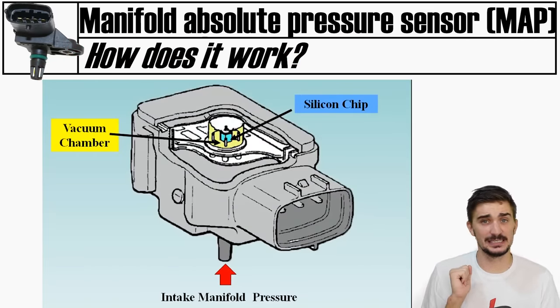The IAT sensor or intake air temperature sensor measures the temperature of the intake air. This is important because air density is influenced by temperature - hotter air is less dense and contains fewer air molecules in a given space. Although an engine could theoretically run without an IAT sensor, it runs better with one. The IAT sensor works together with the MAF, MAP, or AFM to give the ECU a more complete picture of the incoming air, helping reduce emissions and improve power and efficiency. Like almost all other temperature sensors, the IAT sensor is a thermistor - its electrical resistance changes in response to temperature changes, and this resistance is measured and converted into a useful signal for the ECU.